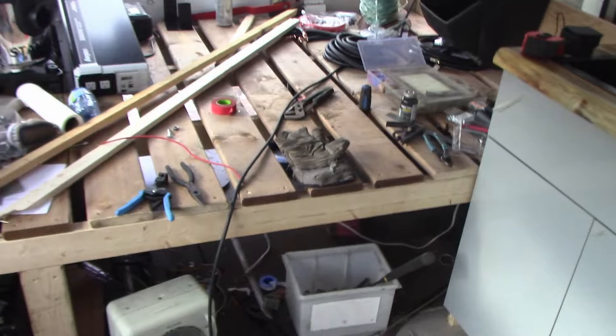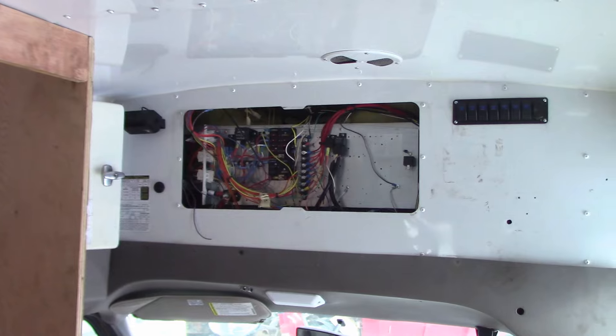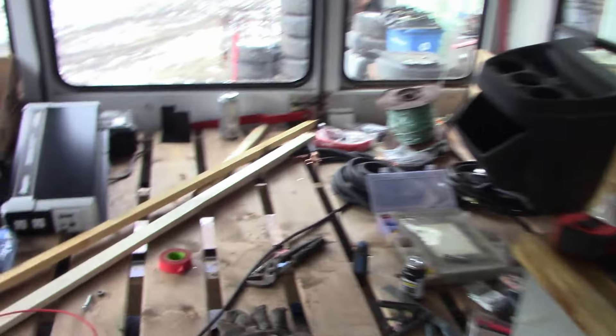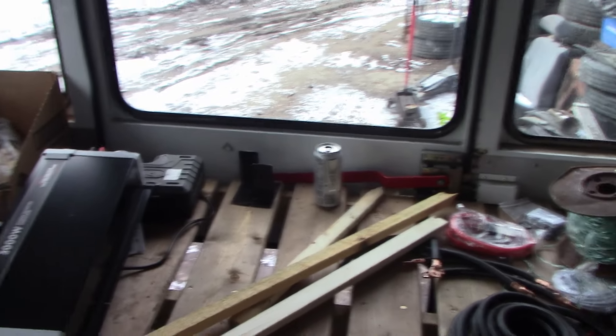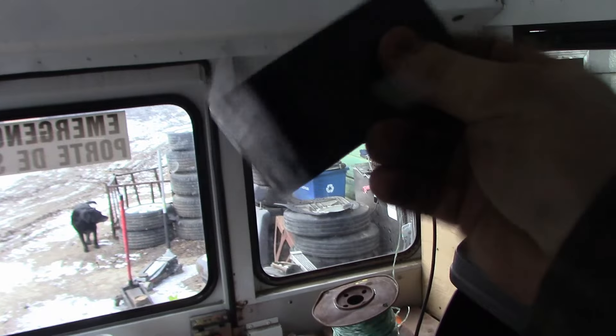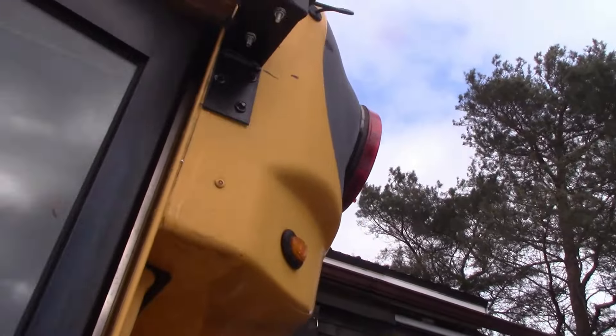That's what we did for that. We bought a water jug but unfortunately it's too big to fit underneath the bed or the sink, so we won't be using that. I'm slowly working away at this. I think I'm going to use the side backup camera mounts — I'd like to get those mounted today so the camera isn't smashing off the side of the bus in the wind. I built two different styles: a simple L-bracket with four holes and a T-bracket with four holes. I'm going to try the T-bracket first. And there you go — the side camera is now installed.